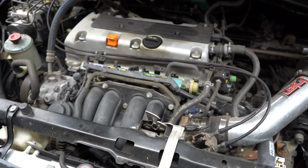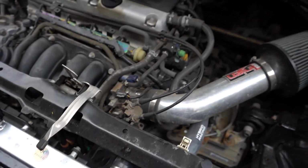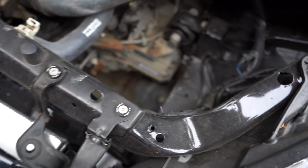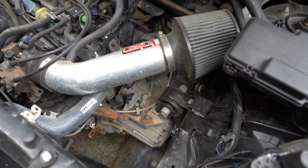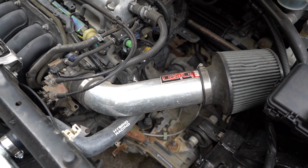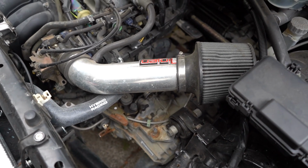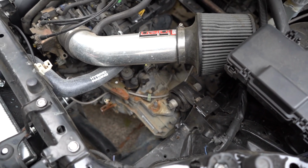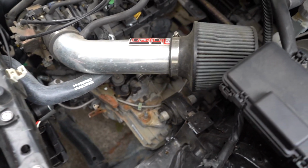The original engine, I'm not reusing anything on it. I'm just going to pull it out and use it as a spare, and I have another transmission too, so this will also be a spare. My plan for my mounts is to buy brand new mounts and fill them with urethane, and drill extra holes in them just so the urethane grabs a little more so it doesn't fall apart. I don't want vibrating, so I don't plan on launching it.